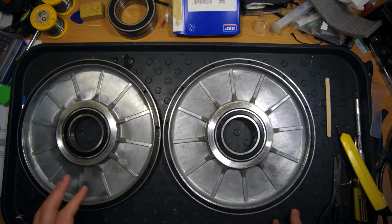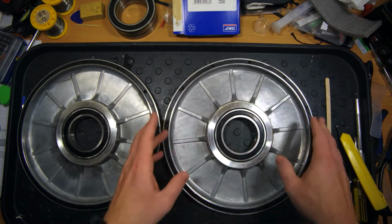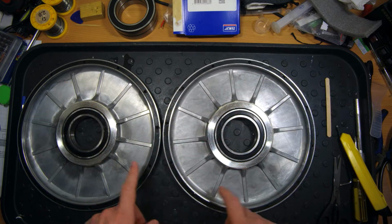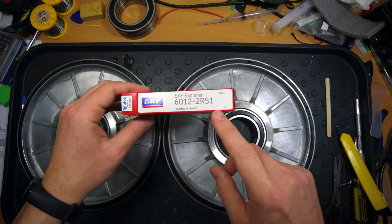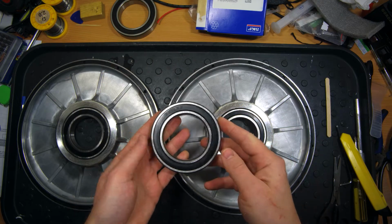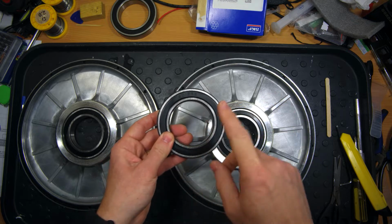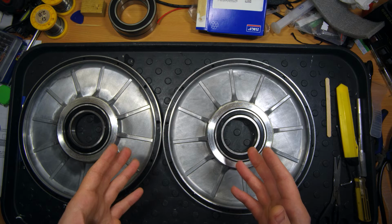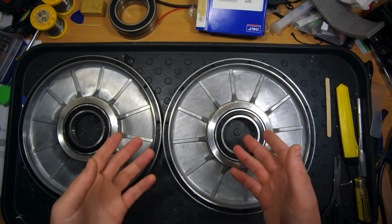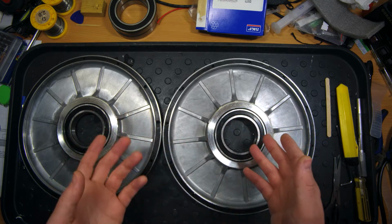Let's discuss the assembly quality of this wheel, starting with the motor. You may see I've already created the cool gaskets here on the covers. I've already changed the bearings to these ones. In the previous video about RS version 3, I showed you that the bearings installed in stock are much worse than SKF. So now, as the bearings have been changed, the owner of this wheel will forget about any problems with the motor for quite a long time.